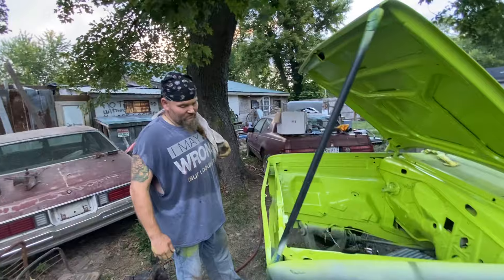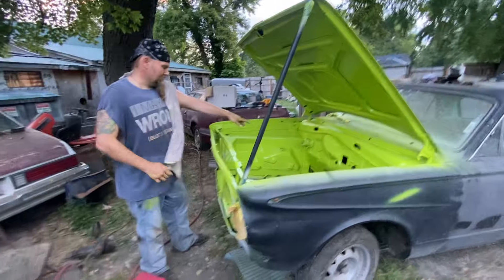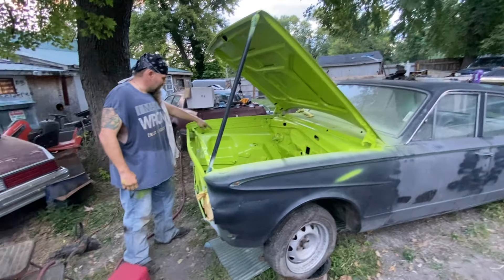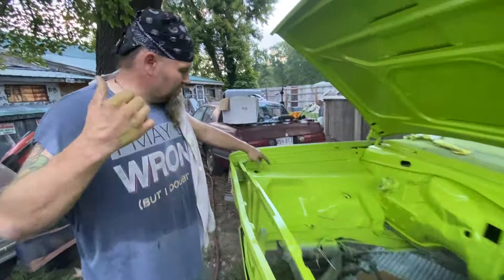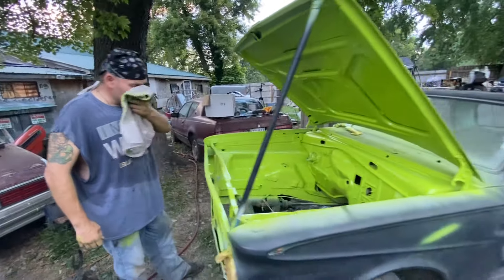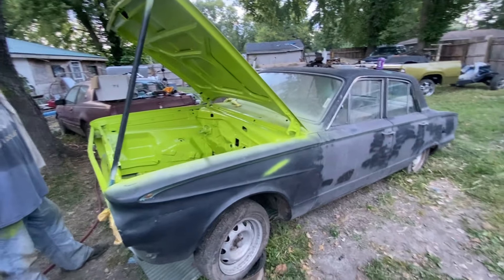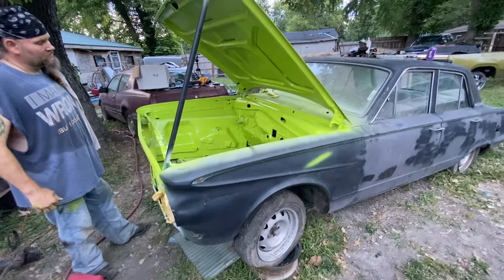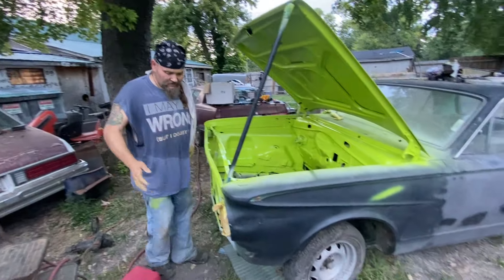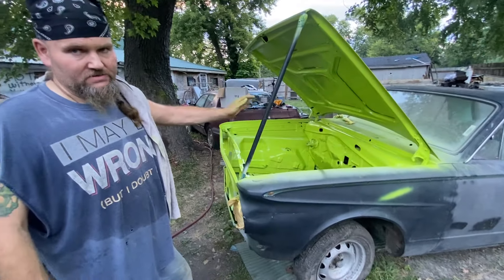What do you think, Dad? It turned out good, but I mean there's a run over there — I'm not going to deny it. But right here in the factory area, there's something with the metal — it's actually in the metal. So we'll have two sublime green cars on the channel: we'll have the Dart and we'll have this one. My car is base clear, this is one-step. It's not perfect but it's close — it'll turn out maybe three times better once we do the outside.